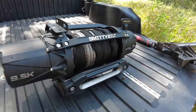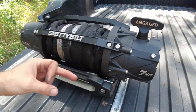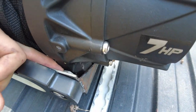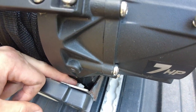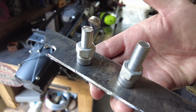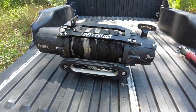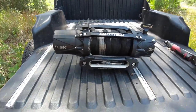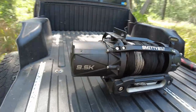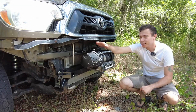Here's the winch and winch plate combined together. You can see the fitment — with the bolts there's literally only enough clearance to fit a piece of paper between the bolt heads and the winch body. I actually went in and shortened the fairlead bolts just to tuck the fairlead as close as possible to the winch body. I'd say she looks pretty good.